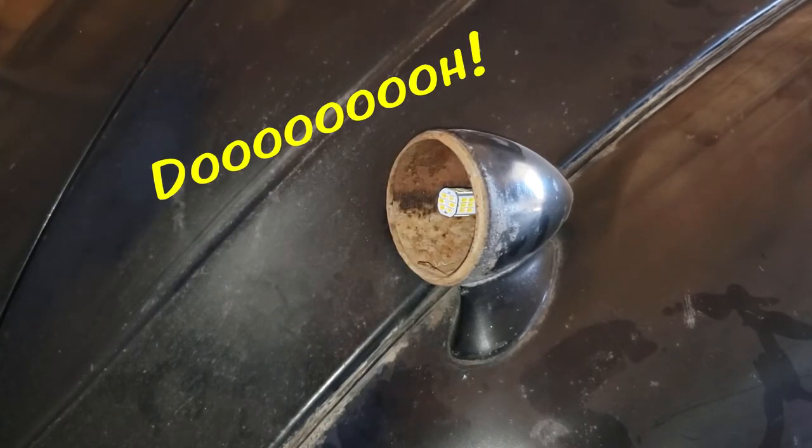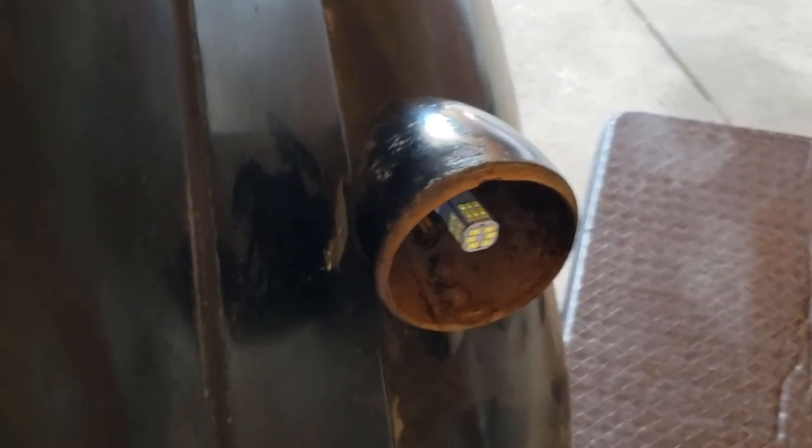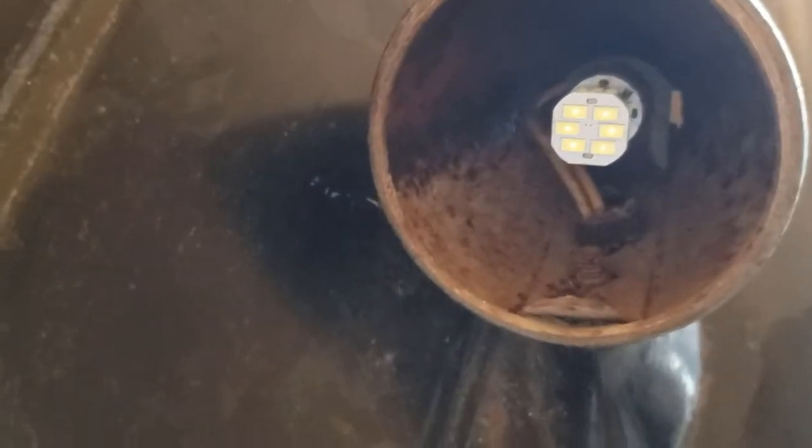Houston, we have a problem. After installing both LEDs, we run into a problem — the driver's side works just fine but the passenger side does not. It turns out, after some investigating, it's got an open ground. These particular bulbs run all their grounds to the metal chassis. So what I've done is connected a wire here that connects to this wire here, and when I ground out the side here — let me turn this on a little bit.